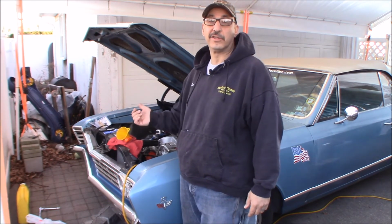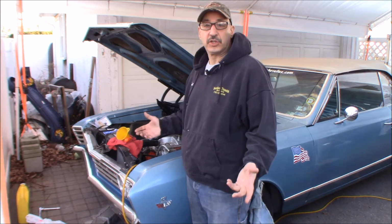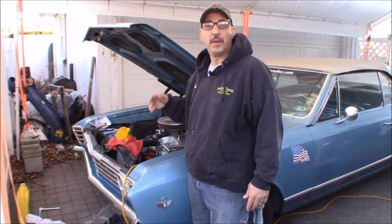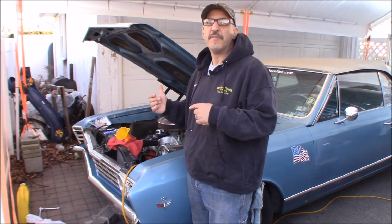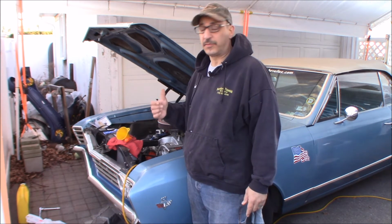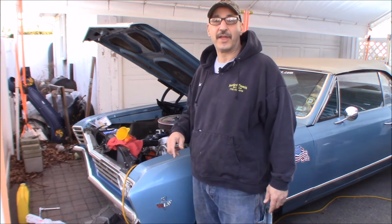All right, so I put a gallon of 25% antifreeze or coolant to 75% water, and then I had to put another 2 gallons of straight water in because that's all I had. I just want to get it so I could start it up now, let it warm up, get that churning through, and then maybe I'll just dump it all out tomorrow and put a 50-50 mix in, because I've been down this road before. It's early April. It could get cold again, and I have popped freeze-out plugs in this car when I was running straight water, so I don't want to have that happen again.